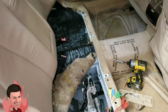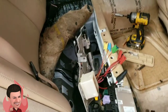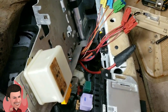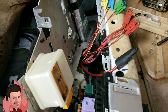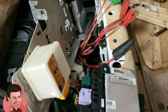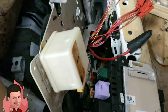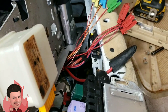Right here is the back of the S-Class with the rear seat removed. Once you get under there, there's a rear SAM — that's where a lot of the power distribution is sent through the vehicle. The first thing we did was check power, because we have a code for no communication with the rear SAM and the right front SAM. I have the wire covered with a rubber glove so it doesn't arc anything, and that wire had power.